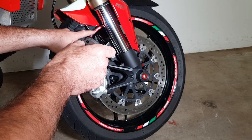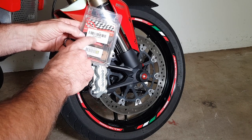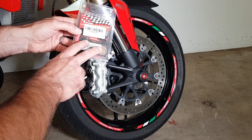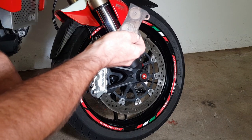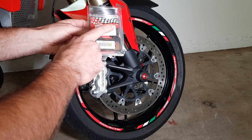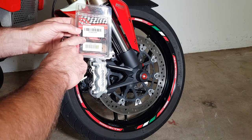On the forums they tell you to change the calipers and fit M50s, which requires a modification because the mounting point for the fluid lines is in a different place. You also need to change the brake fluid lines. However, what you can do first is upgrade your brake pads. EBC make some really nice ones. These Brembo SR pads came out in 2021 — I think March — and they're really good. However, when you start fitting racing brake pads you change the temperature range in which the brakes work.